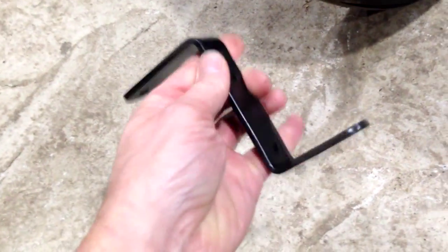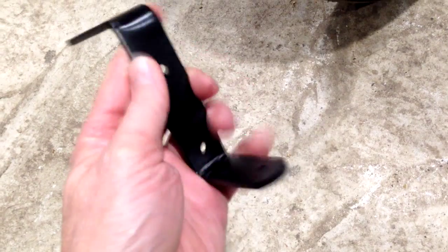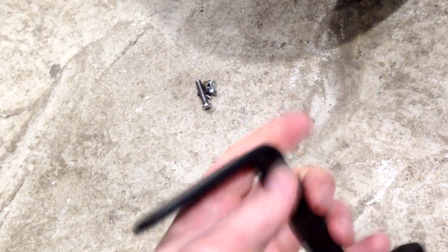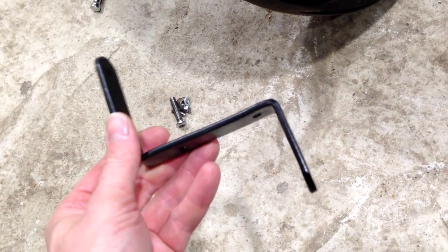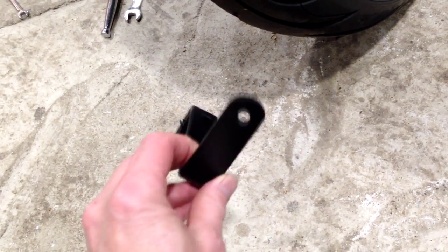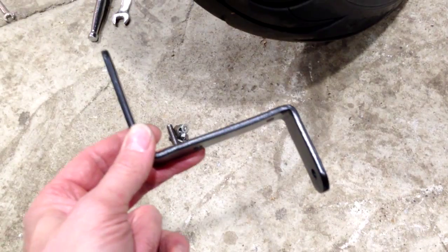Okay, so the bracket's now made. It's rather heavy duty for holding a mud guard on. I probably could have made it in a much lighter, thinner metal. And I also mucked up the making of it because I didn't have it hot enough when I was bending here, and I've got some cracks. So the chances are that, thick as it is, it may well fracture. But if I need to remake it, I'll make it in something a little bit thinner, I think. Let's see how it actually survives on the bike. Given the previous bracket and the mudguard were both cracked, I think heavier is probably safer, even if unnecessary. So let's see how it goes putting it on.